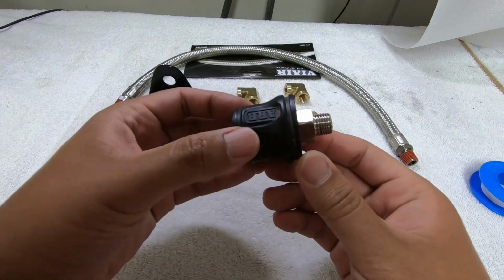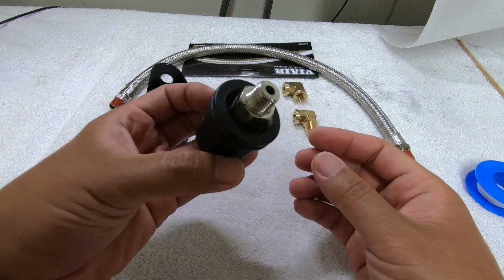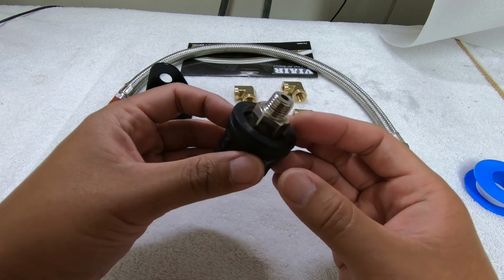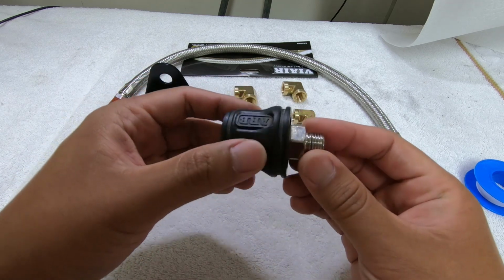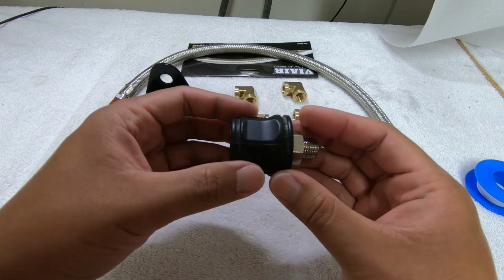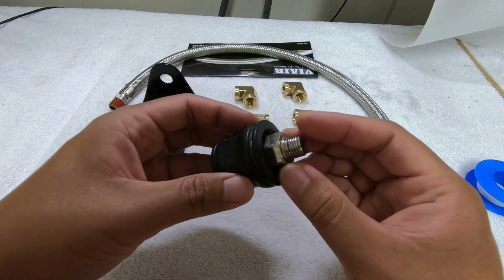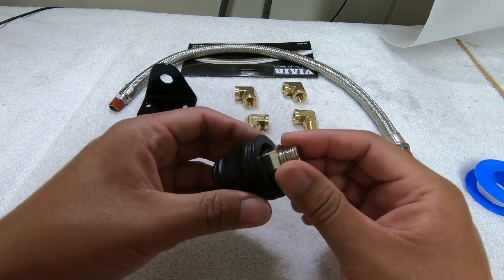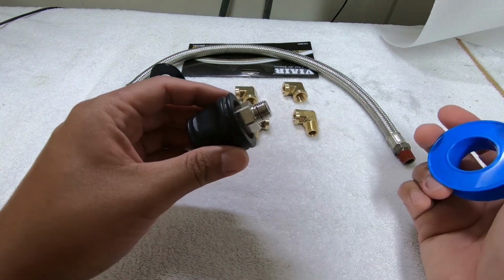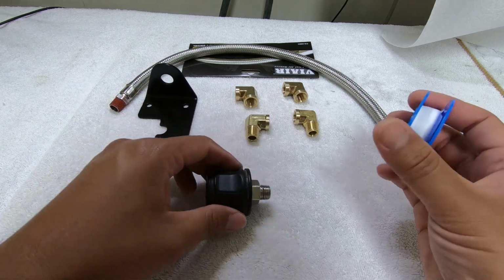So first of all, you'll need to get your air hose quick coupler. Mine came off of my air tank because I've been using it. If you don't have one, it comes available in the ARB Air Up kit, which includes this guy, the hose, and a couple other fittings for the tire, which is actually really great. I'll list that in the description down below also. But let's put some Teflon tape on these threads to make sure that it does not leak.